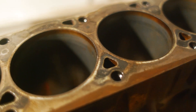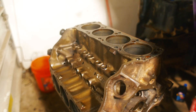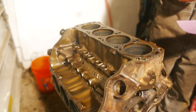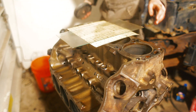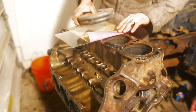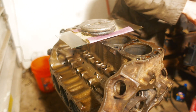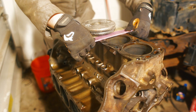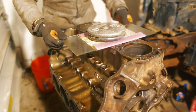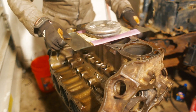What we're going to do is take a piece of sandpaper and level it out. We got some high quality wet-dry 400 grit paper, and I'm going to spray this with a bit of oil as well. I've got a piece of glass here and ten pounds of weights. Because this is glass that I cut myself, I would definitely be wearing some gloves. Then it's just a matter of back and forth as many times as I can.